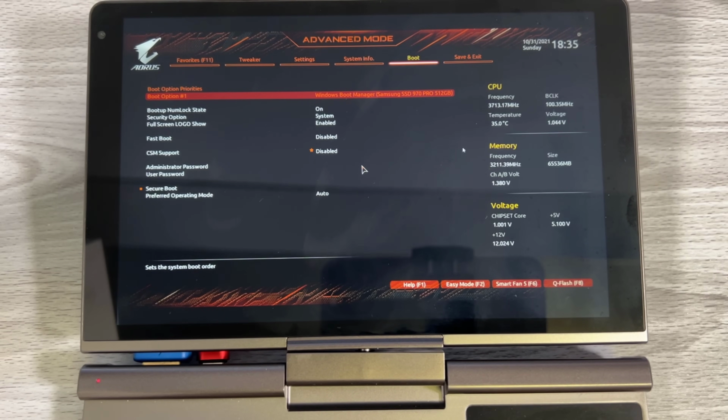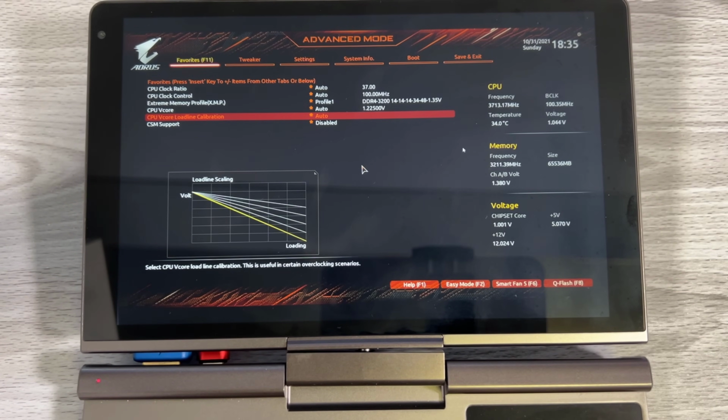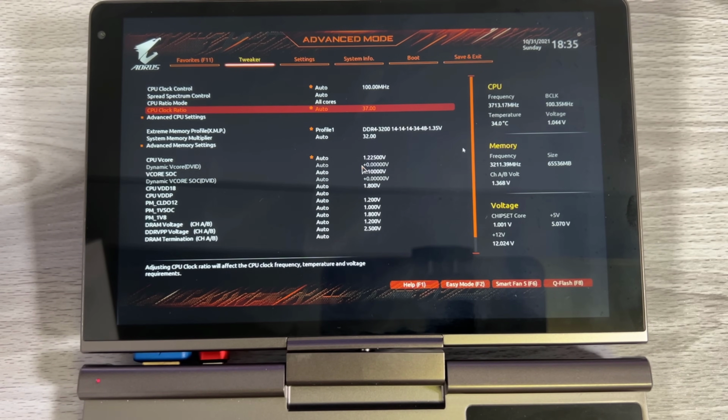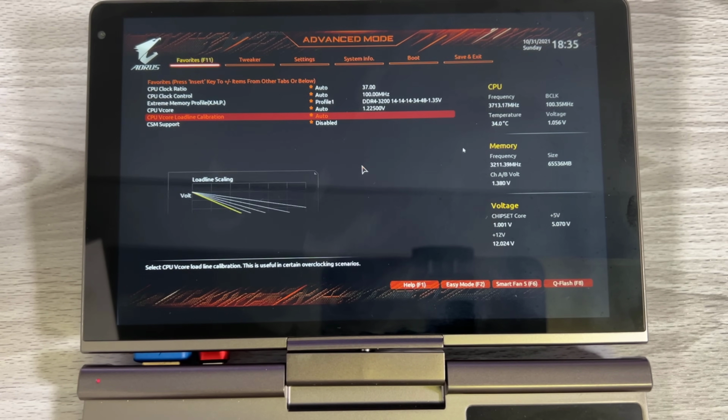Really happy this worked out, better than using the web interface and better than connecting a physical keyboard and monitor to this. So while I didn't have the perfect success with VGA to HDMI with regard to BIOS interaction, hooking it up to my machine that has HDMI out, I had zero problems taking a look at the BIOS and interacting with the BIOS. So for system builders or someone who interfaces with a machine that you need to connect to and operate on, the Pocket 3 really is an excellent portable KVM in this regard.